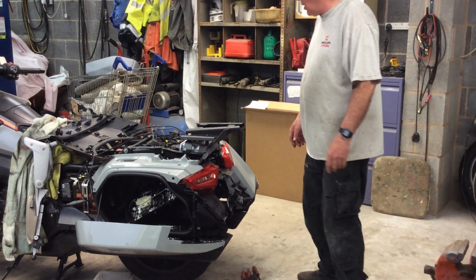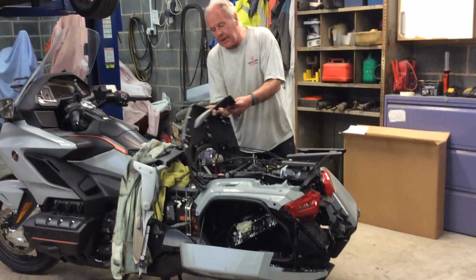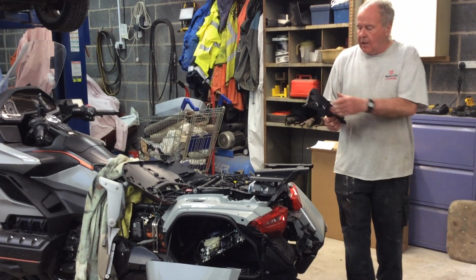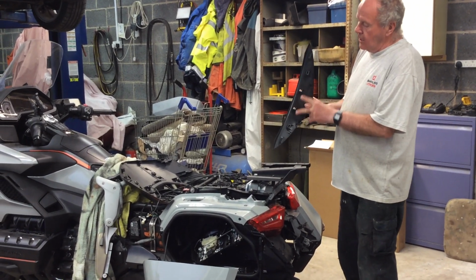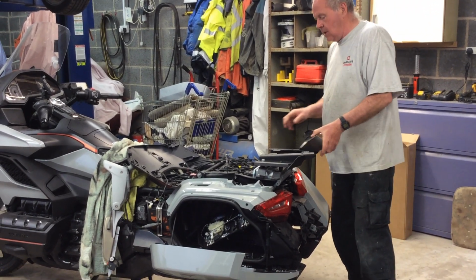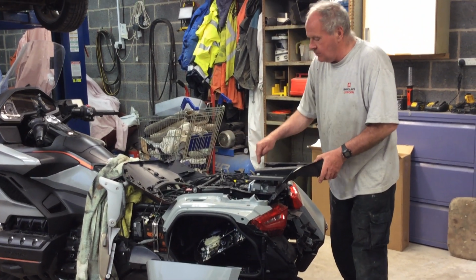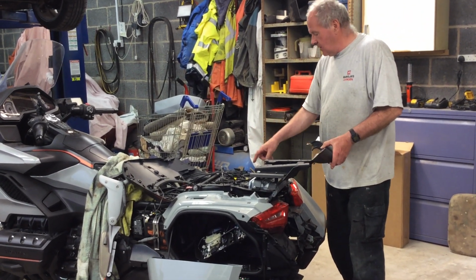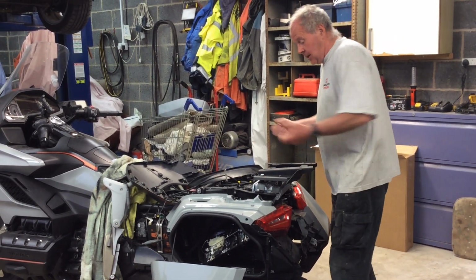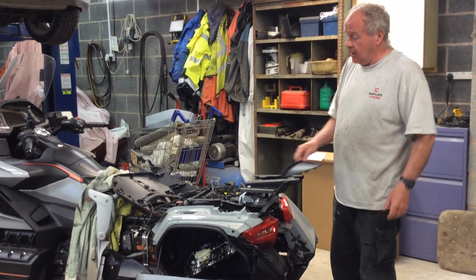The biggest problem you've got is this plate here. Of course, this fits on the back of here. This is tight, very tight. You'll find that it's these 2, and then you've got 2 reverse ones going there and there. So basically that goes in the back. And then you've got these ones here, and 2 little pins and 2 little bolts here. When you've taken the pins out and those 2 bolts, you really need to get a towel on it and literally get your elbows in. You have to give it a fairly good whack and then it'll pop out.